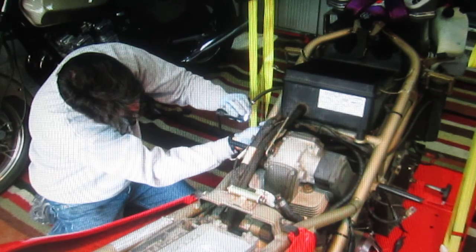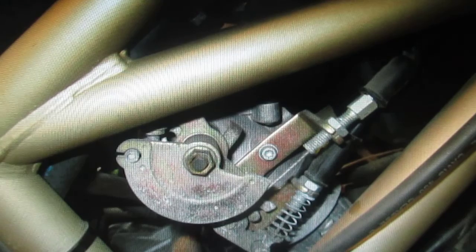Another thing I do in the shop when doing an unfamiliar project: I put parts starting at the back wall and line them up in sequence as we take them off, so that when we go to put this back together we can work backwards. As you can imagine, we had worked on this bike before — did the chain, changed the sprockets — so we had a little experience, but we had not taken the engine out yet.